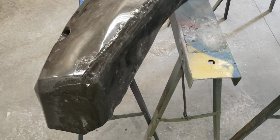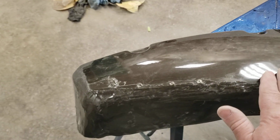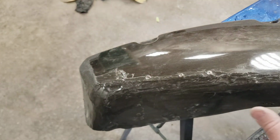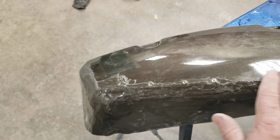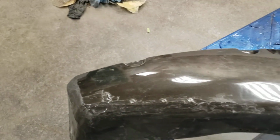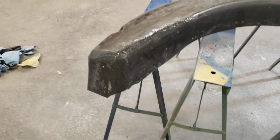It will hold. A lot of the other stuff, not so much. So then what you'd have to do is make sure you put enough filler, if you're using spray bomb stuff, that you don't see any of this, just the fiberglass filler, which the spray bomb stuff sort of holds onto, at least better than this. But that's what we're doing today.